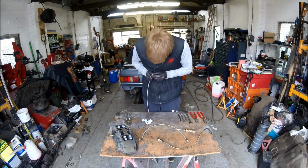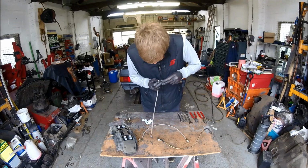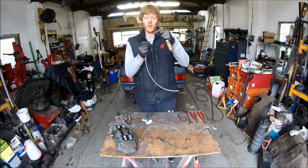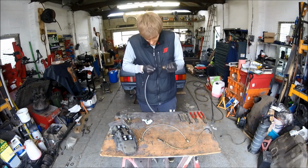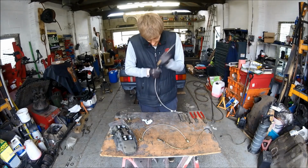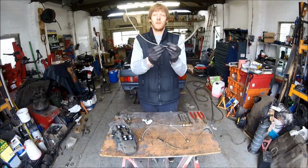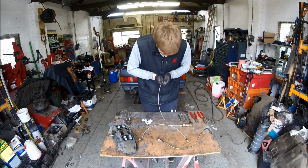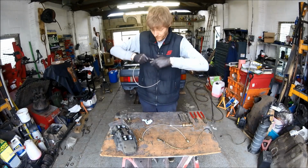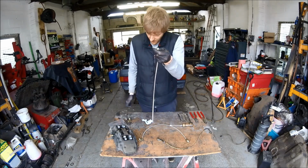And then you'll know when you've got it far enough. I won't be able to show you because the camera's not got a small lens on it, but basically the olive on inside will only go so far onto the pipe. Once you're there, firm grip, couple of little taps, see that's not going anywhere, and then now what you do is your fitting that you've already put on there, you slide that up to this end, push it over the top of the braiding that you've just picked off, so you'll just pull it like so, and then you'll be able to see inside the pipe that we've got the olive and then now our fitting.